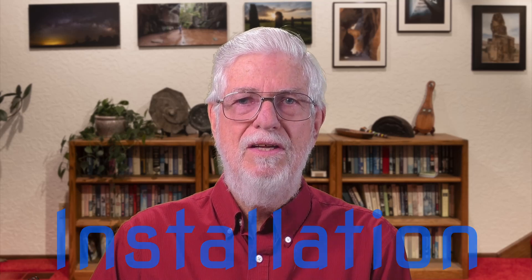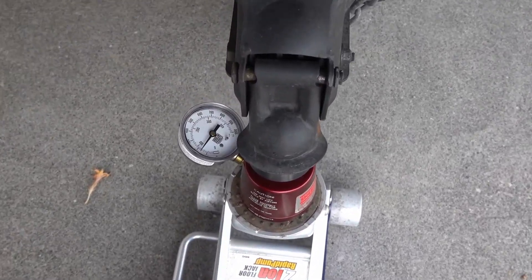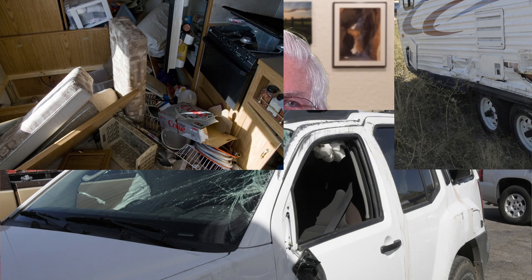Now let's talk about the actual installation. The simplest way would have been to replace the lead acid battery on the trailer tongue with the lithium one, rewire the existing power converter, and stuff the other components in wherever there was room. It would have worked, but it wouldn't have been pretty. And for no good reason I sort of wanted to keep the original system usable. It was also important not to mess with the trailer weight distribution very much. We bought this camper because it has a base weight of under 1,600 pounds and a gross weight limit of only 2,500, which means it can easily be towed by a mid-size SUV. But its tongue weight is thus only about 160 to 200 pounds, and the existing lead acid battery accounts for a big chunk of that. I had a trailer wreck some years ago due to towing stability problems, so all that lead is staying put on the tongue.